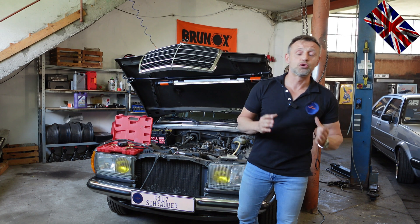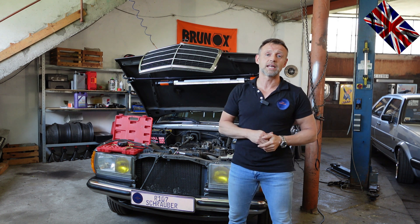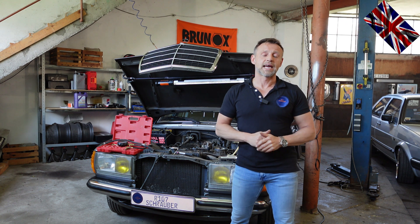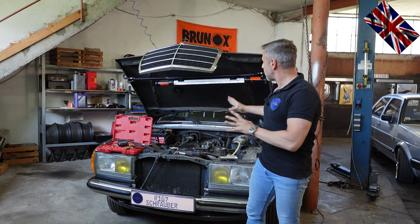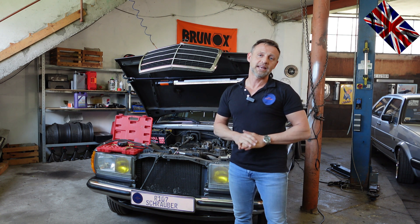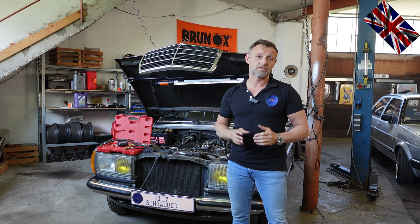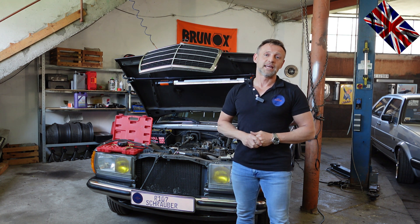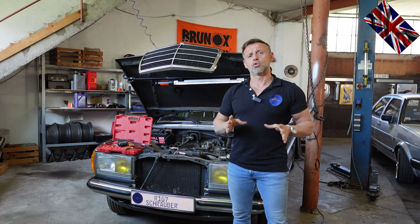We check pressure here at an M-102 engine, four-cylinder. This is a W-123 from 1985 — the last one with a K-Jetronic before KE-Jetronic was introduced. The WUR is sitting close at hand and easily accessible; ports can be reached without starting aerobic lessons with Jane Fonda. In comparison, on an M-110 engine this component is in the dungeons of the engine bay — you need a lift to reach that device.